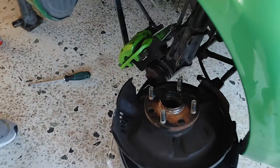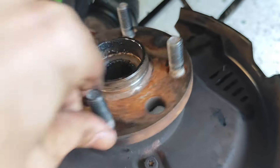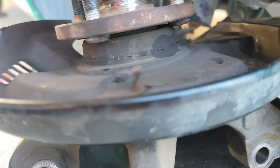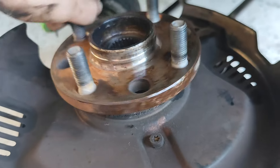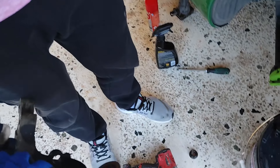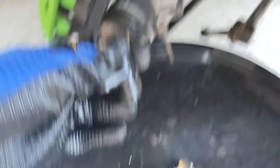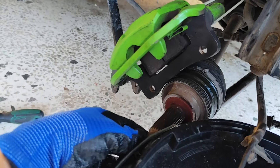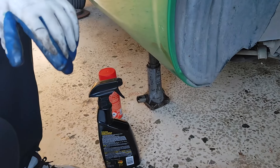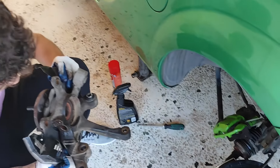Alex joined us and we removed it. Listen to this sound — the balls are now like squares or triangles or octagons. It confirmed that it's bent. The solution for the ABS being completely stuck was to knock it from the other side, from right here, and it came right up with no damage. So we're good. We'll have to install a new one — remember it's a mandatory replacement. Now let's get started with the other one and check it out.